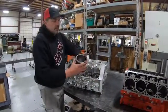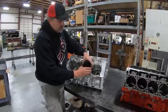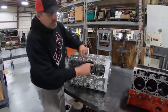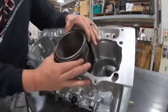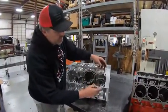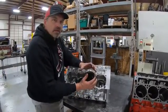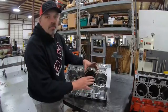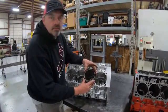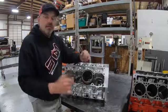I want the deck surface to be uniform and solid, with a sleeve top across it. What I've found is that with a wet sleeve or mid sleeve design, I just can't get the head gasket ring to stop leaking, because there's nothing really capturing, supporting, and clamping everything into one solid unit. The tops of the sleeves can move — this is exaggerated, but it only takes a thousandth or two of movement to eventually bruise the gasket and cause a leak.